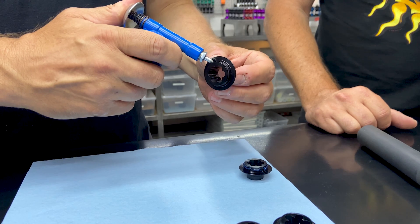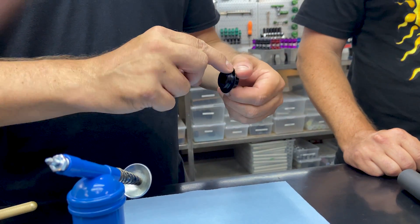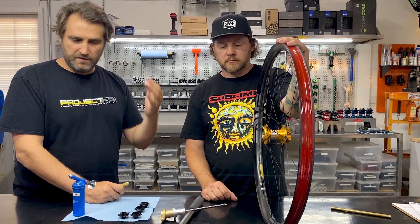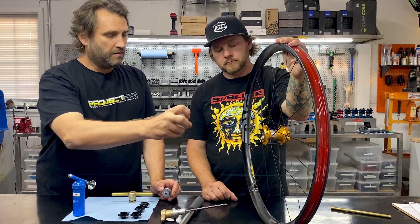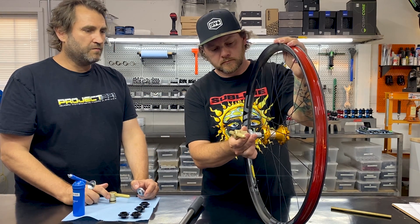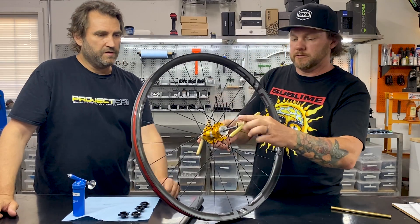You almost can't put too much grease, to be honest with you. The end caps are identical — ambidextrous. So we just get a little grease on these O-rings so they go in nice and easy. But before we press those in, we're going to take our bearing press. We use a basic bearing press with 6805 bearing drifts — they're available online from a number of makers. Sometimes when you pop these end caps out, it can pull the bearing out just a little bit, and for everything to be nice and snug with no play, those bearings need to be bottomed out against the bearing spacer inside. So we're going to slide this in on one side with a 6805 bearing drift, and put our 6805 bearing drift on the other side.